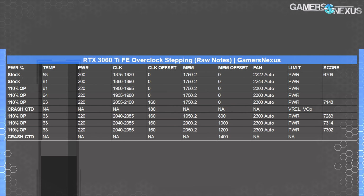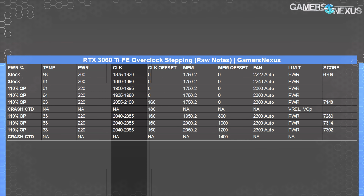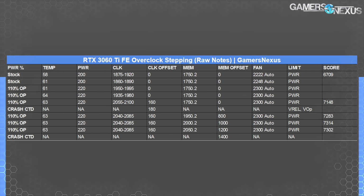The temperature column isn't that useful here, and you shouldn't be taking it as a measure of thermal performance. The previous charts did that. It's only there to correlate against the frequency, which changes based on thermals, but because these tests are constantly crashing or restarting, there's no constant load, and so the temperature chart isn't meant to be used that way.